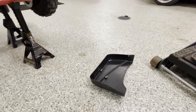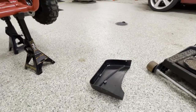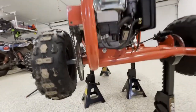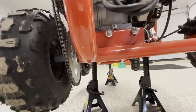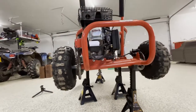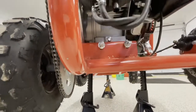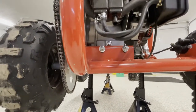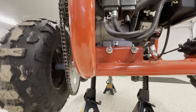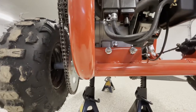You can see our chain cover here — I put the three bolts and nuts in there. Let's orient ourselves a little bit. Here's the back of the engine. These two bolts here, right at the bottom of the engine — they're the ones we're going to use to tighten and loosen the chain. Now really importantly, tightening those bolts is going to pull the engine backwards to tighten the chain.